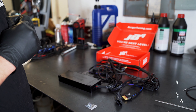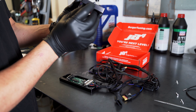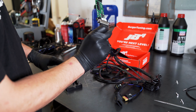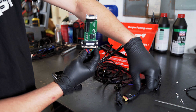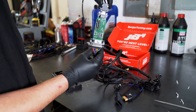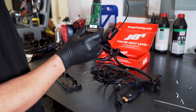Alright guys, so once we remove the four bolts, we will now be able to remove the cover on the JB4. You'll see it looks like this. It does have this little grommet here on the end we will have to remove — set that to the side. Here, if you look at the beautiful P46 chip that comes inside the JB4, you'll see at the end there is a connector that corresponds to our connector here on the Kinect kit, and these two will go together. They will join permanently via those two bolts I showed you earlier. So let's go ahead and do that.